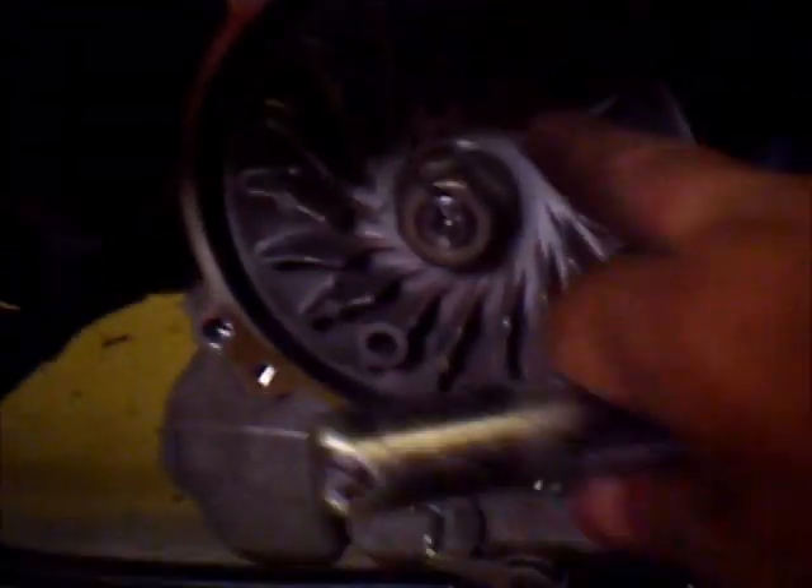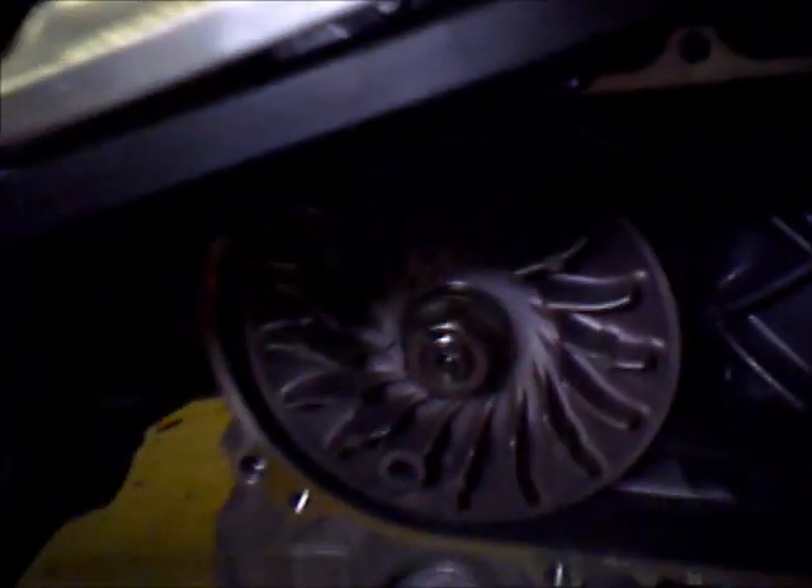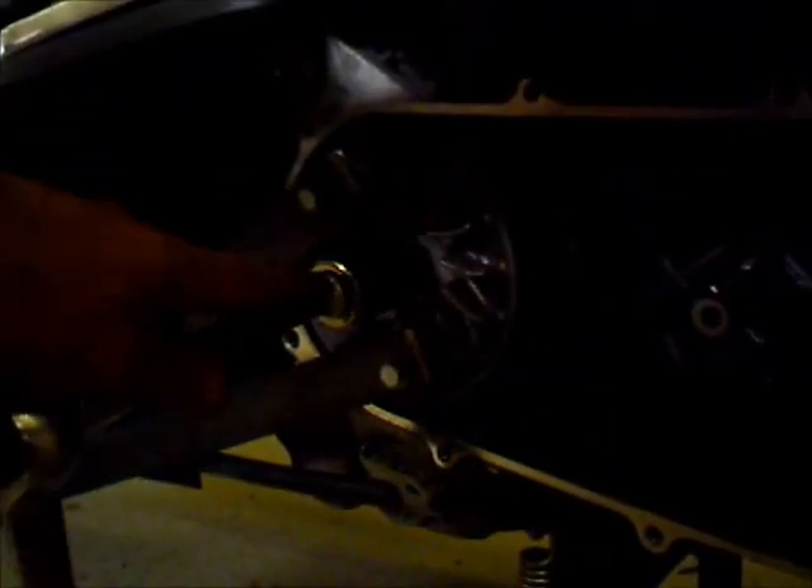Cool. Now what we've got to do is get that bolt off. We've got a little holding piece right here and right here. This is a variator holder — as you can see, it's got the bolt that comes through. That bolt and that bolt, and as you can see, it's variable. Those bolts will fit right in those holes to hold that when I take that big honking nut off. That socket is a 22mm socket. I've got the holding piece in place, and now I'm going to do my thing.